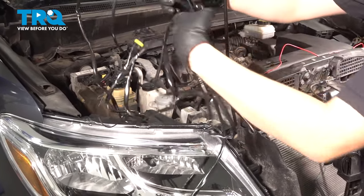The relay and the fuse — I think this right here is a great spot for them, wedged in there nicely. I'm going to take this air duct or intake ducting off — it's a 10 millimeter bolt on the top of it. Mine has a nut underneath, but yours shouldn't; someone's already been in here and broke the factory mounting hardware. Take this off on the other side as well. With those off, you should be able to pull this up and away, and now we gain access to this area, which is where I want to run my wire.